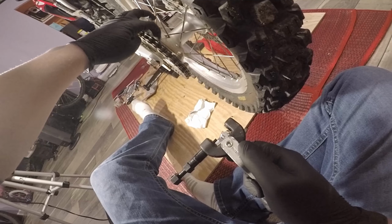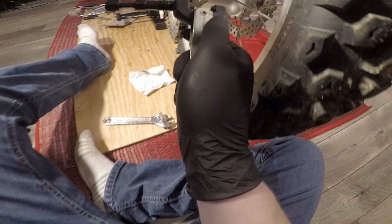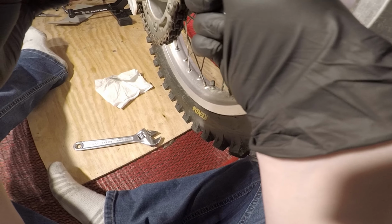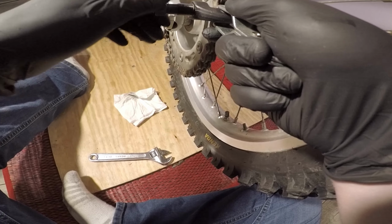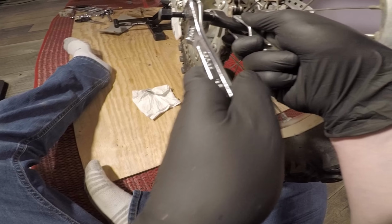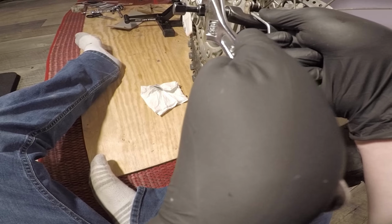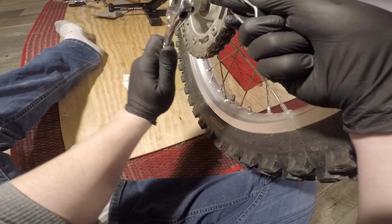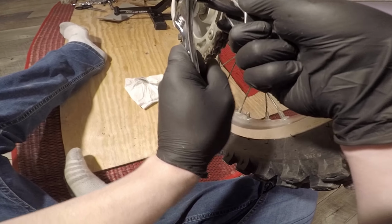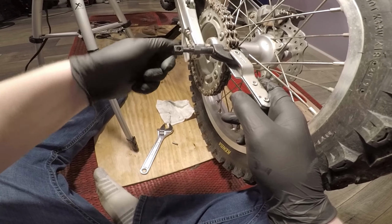Yeah. And as you can see, she's coming out. So it's good to do that. It's good to take the whole assembly off, then reslide that back on, because that lets you know, as you can see, that pin is 100% inside the cutout. That allows that to push straight through the opening. It'll get tight, and then it'll start to loosen up again, and that's it.